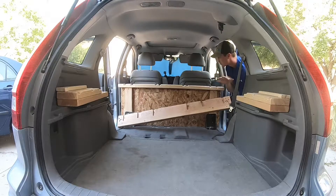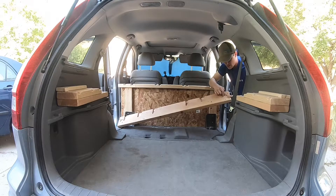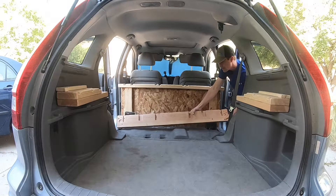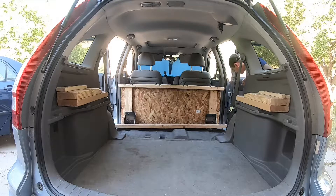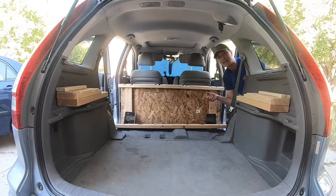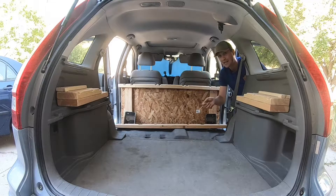You'll notice throughout the whole setup there are indentations where all the bolts go so that the bolt tops are out of the way. The rest of the project uses quarter-inch bolts that take an 11-millimeter socket. Everything takes the same size of bolt except for this piece here, which takes a longer one, so I like to leave those in when storing it so I don't lose them.